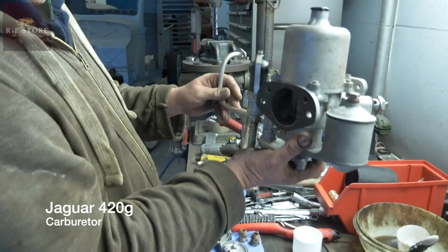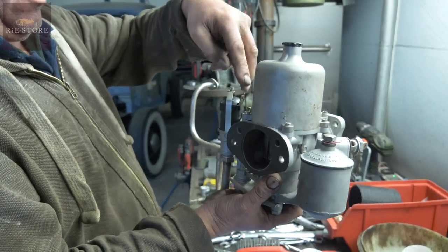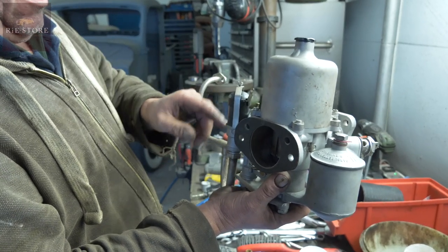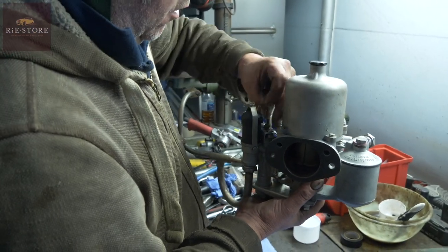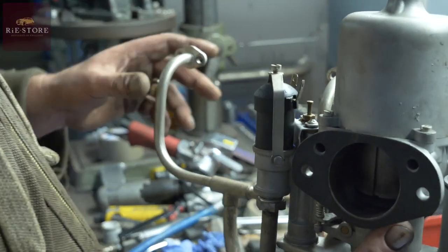So you have the otter switch on the manifold, which I can show you on the car, which is wired in through there. That's just an electromagnet, pops up the valve, lets the fuel through, and that's regulated. When that pops up, that needle drops down, sucks down on vacuum, and you can adjust your mixture by that nut there. That's just for the choke circuit though.